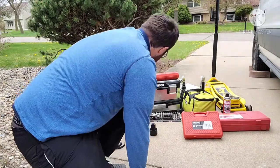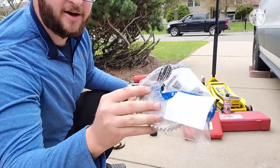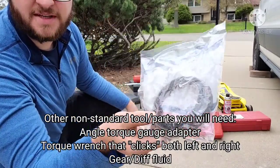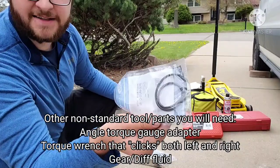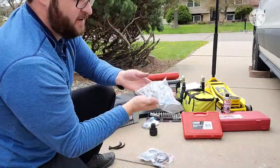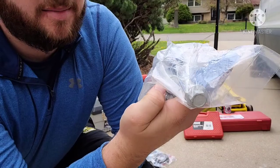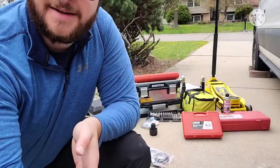And then a few parts. Obviously you're gonna need your new tone ring. I'll put all the part numbers in the description. You're gonna need a new hub seal, an axle shaft seal, and Ford recommends replacing the bolts that hold the axle to the hub. So I bought these; they're like $1.50 each, so actually cheaper than the front ones, even though they're like three times as big. So that makes sense.